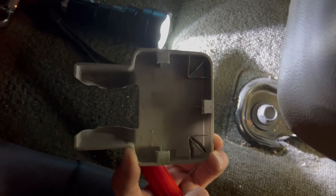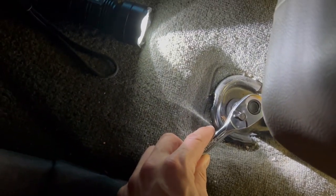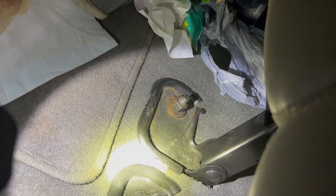I'm in the back seat and I'm going to start by removing a bolt underneath here and then that back one. There are 19 millimeter bolts, I think. First we have to pry up this little plastic piece — I just used my pry tool and it came right up. You've got three clips on either side there. Then use your 19 mil and we'll get that removed. The other one's a little taller and I don't have the deep socket hex set, so I'm going to pull this little plastic nub off first and then just use a standard wrench.